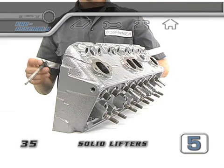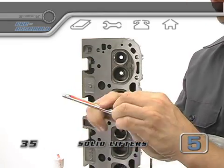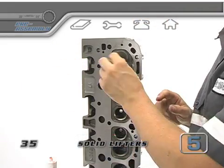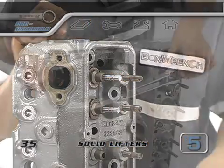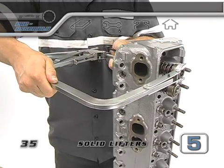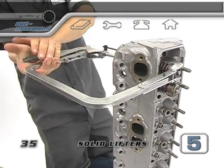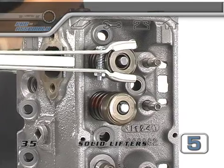If you need to build one of your heads with the stock springs for the test, pull the correct intake and exhaust valves out of the organizer tray for the number one cylinder head. Make sure the valves have some lubricant on the stems, put on any spring shims if you have them, and then the spring and retainer. Most likely you're going to have new springs or shims that will make the old springs tighter, so squeezing the valve spring compressor by hand right now might feel a little bit tougher.